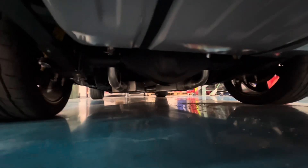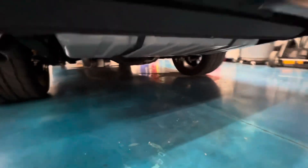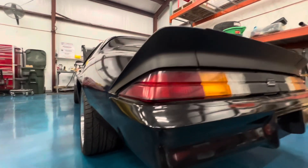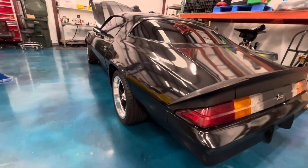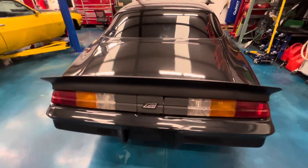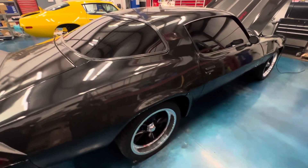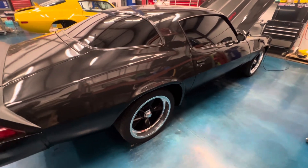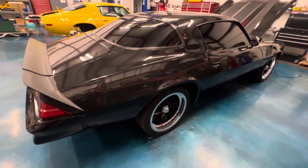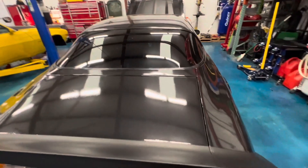Underneath the car we completely undercoated the entire underside. As mentioned, we did a trunk pan, so it's been seam-sealed and undercoated as well. We ran a Painless wiring harness front to back — every single wire in the car is brand new. A lot of the cosmetic body parts are original: original spoiler, taillights, bumpers. But the car has been completely vinyl wrapped by my buddy Josh at Saturday Night Signs — it's a gloss black metallic wrap, with matte black metallic on the spoiler and the hood stripe. Evan's Tent and Alarms out of Pensacola did the window tint: 5% on the side windows and rear, and 40% on the windshield. Adam at All About Auto Glass did the install on the rear glass and windshield.